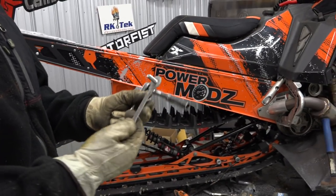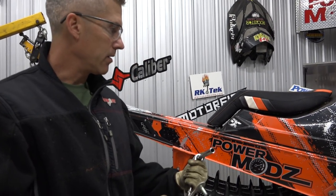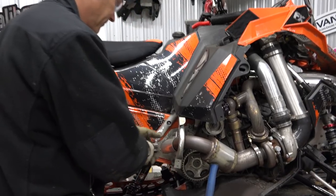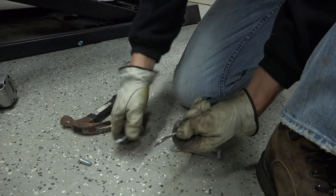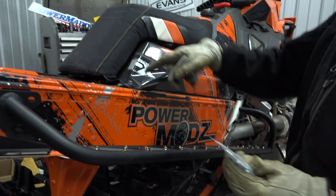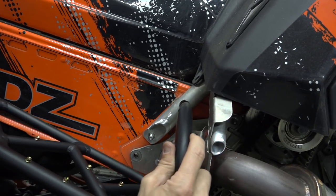This is what we're dealing with — it comes from the inside of the tunnel out. This is marked with a 'top' because there's a little bevel in the tunnel, so we want to punch this out. I'll show you how to do that and then we're going to thread our own bolt into the board. Now they have supplied all the hardware. Make sure no hardware goes down your tunnel underneath your gas tank, because then you're going to have a bad day when you have a hole in your tank. Passing that through right there — that's going to go in here.